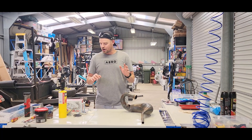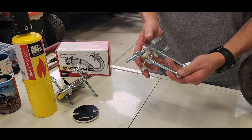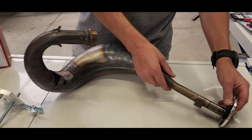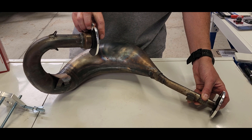I purchased this Minnow Pipe Repair Blowout Kit. This is made for two-strokes. Basically all you get in the kit is pretty basic — you could probably make this up yourself at home. You've got a couple of brackets, a bit of threaded rod, and some butterfly nuts. What it does is you put this here and that will seal on that end, and this side will seal on the motor side. It's got just a car valve or a bike valve there, and the brackets obviously hold these on tight.